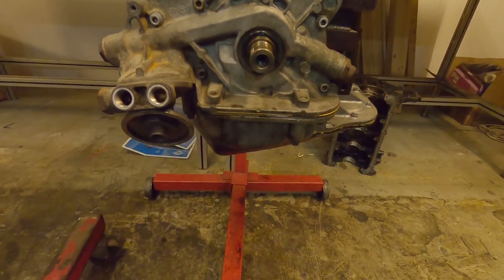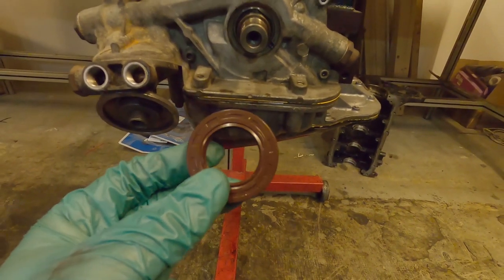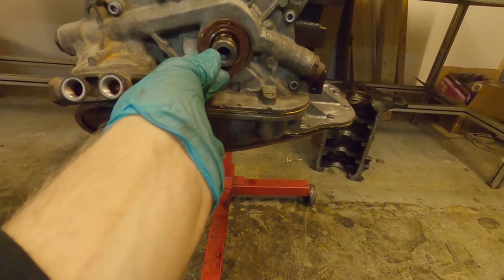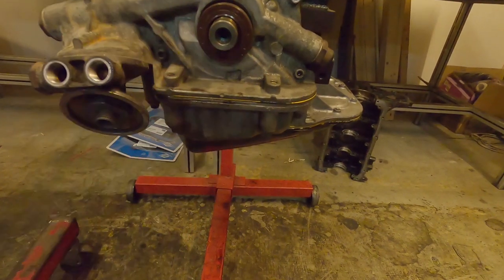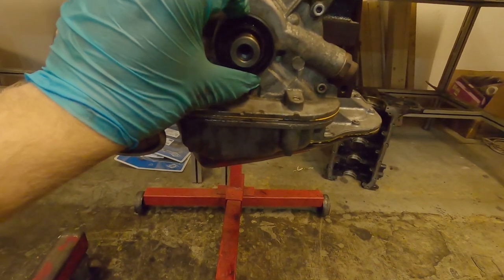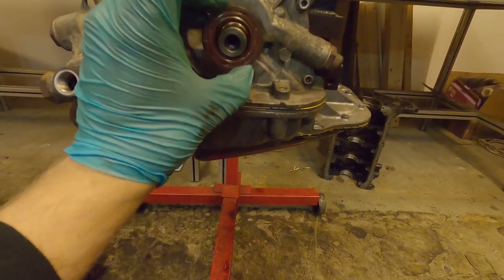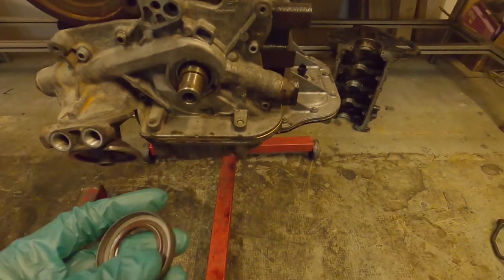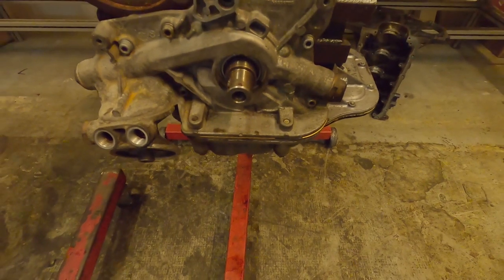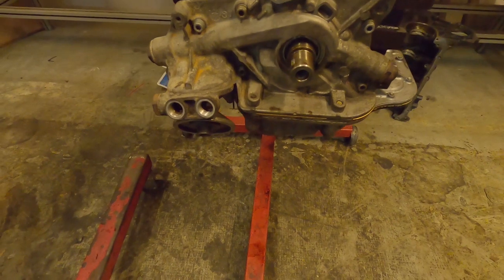The head's torqued down — it's time to install a seal on the end of the oil pump. This is a similar procedure to doing the rear main seal. We've got a seal to install on the end of the oil pump. There's a little spring on the inside, and it's very important when putting this seal in to make sure that spring does not dislocate. One of the easiest ways is to have the oil seal lined up on the oil pump, place your old seal over the top, and then using a socket inside the old seal, tap the new seal in. This can be a bit of a pain — if it doesn't go in straight, it might pop in on one side. You might have to spend some time playing with it. Make sure the spring doesn't dislocate and pop out, because if that spring comes out when you're putting it over the crank, the seal will never work.